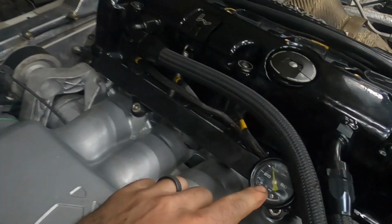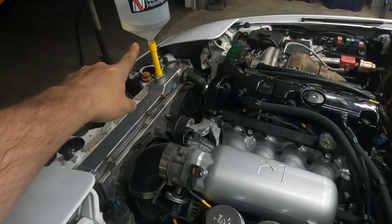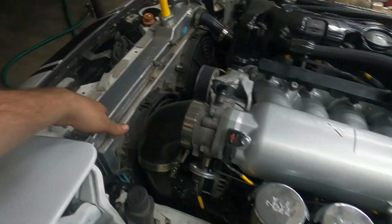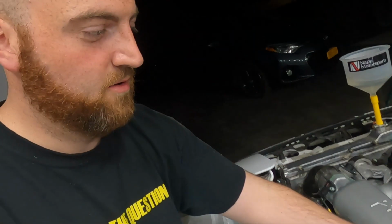Dylan had an O-ring, and as you can see, we are holding fuel pressure, so this is good. I have water in the radiator with some water wetter. That's just kind of the trend now for us, just water and water wetter. We will have to empty it or drain part of it before the winter so that we can put antifreeze in it. But the track car struggles to get up to temperature, which is great. And I kind of want that for this because it likes to run a little toasty.